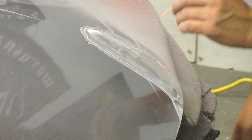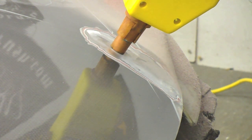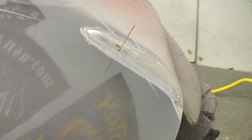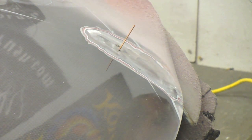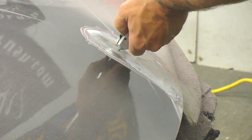What I'm going to use now is what's called a nail gun — I actually need to put a nail in it. What it does is it welds little studs onto the metal like this. Then we have a slide hammer that I pull the dent out with. I'm not going to spend a ton of time on this because I want to show the airbrushing, but I will show this also. Put it on there, connect it, pull the trigger — then this hooks over and slides down.